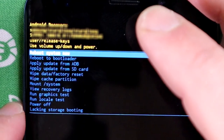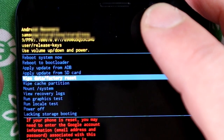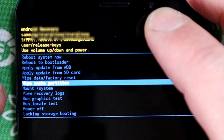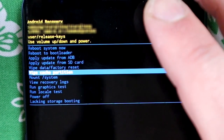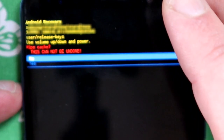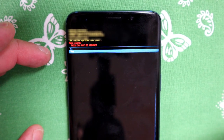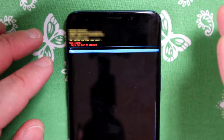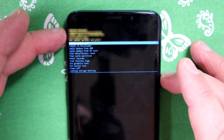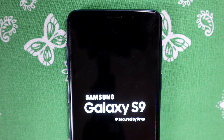What we're looking for is an option called Wipe Cache Partition. Do not make a mistake and go to the previous one, Wipe Data Factory Reset — that will erase your entire phone. The one you're looking for is Wipe Cache Partition. Be absolutely clear that you're hitting that option. Once you select it, hit the power button; it's going to ask you to confirm. Go down to yes and press the button. If you change your mind and want to abort, go back up to no and select reboot system now — press that and your phone will boot up as normal.